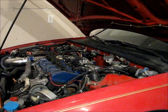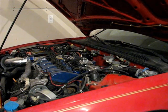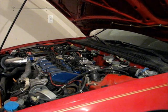but I'll say up front that if you're going to go out and do some shopping, I always recommend going right to Honda and getting the coolant that they intended to be put in this engine. A lot of the stuff that you find on the shelves these days has additives in it, maybe for rust inhibitors or something else, and in the manual and on the underside of the hood you'll often find a sticker too that talks about how the engine is really designed not to have some of those things in it. So if you go right to Honda, you get the right kind for sure.